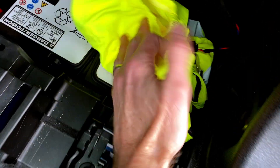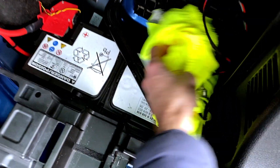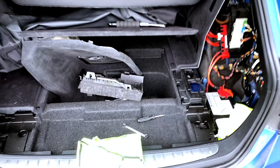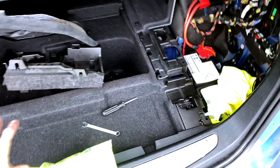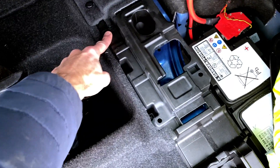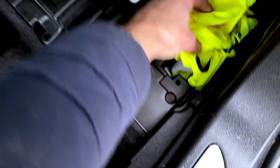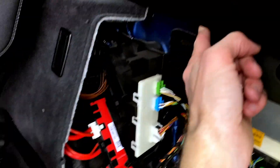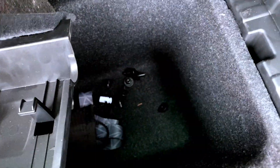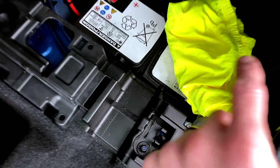The negative terminal is taken off just here at the battery. Getting to the battery in the back of an F30 is a faff — you have to take all of the trim up, take the slim panel off, then lift it. The corner panel has a number of little poppers, and there's a lip on the top that sits underneath the adjacent edge, so you have to pull that out. There's another one that sits under the edge nearby. Then you have to take the tool tray out — a few more poppers — and then you can actually get to the battery.